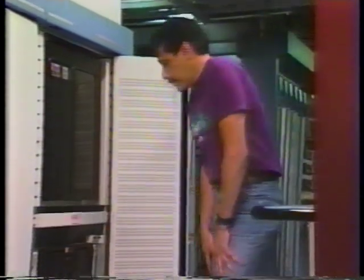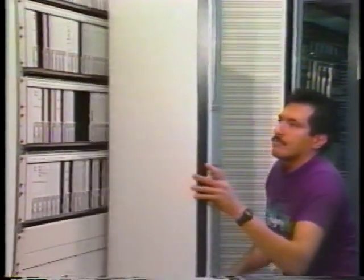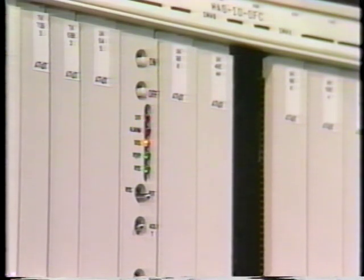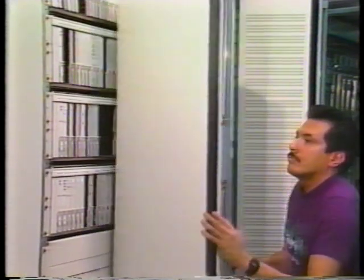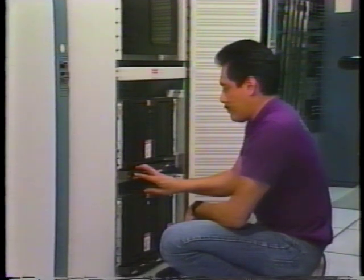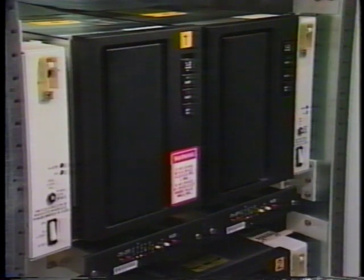Return to the front of the cabinet and restore the circuit breaker located on the front of the power supply. Then locate the DFC power control pack and engage the alarm cutoff and test key first, then the on switch to power up the DFC. The DFC is powered up as soon as the off LED extinguishes. Now power up all of the drives controlled by the same DFC by depressing the on switch associated with each drive unit. Notice that both the alarm and off LEDs extinguish.